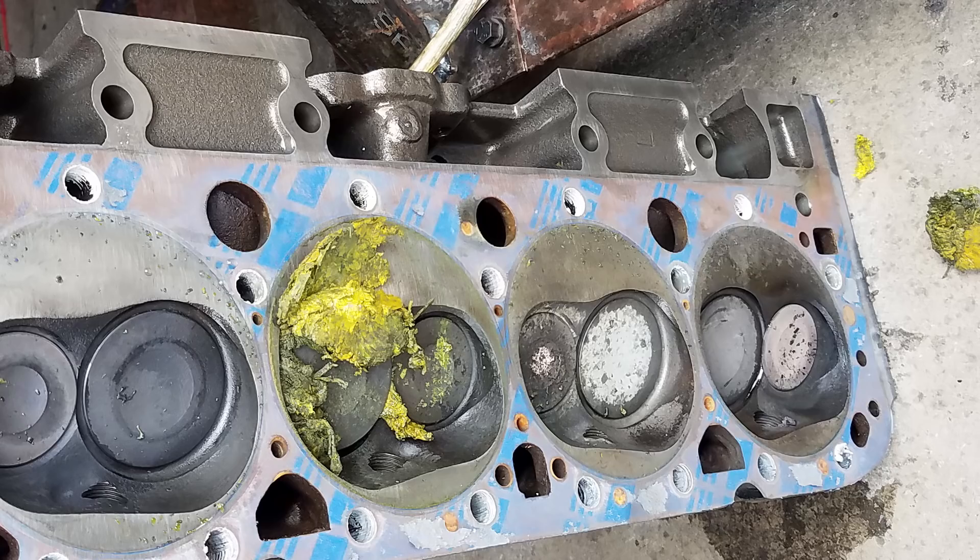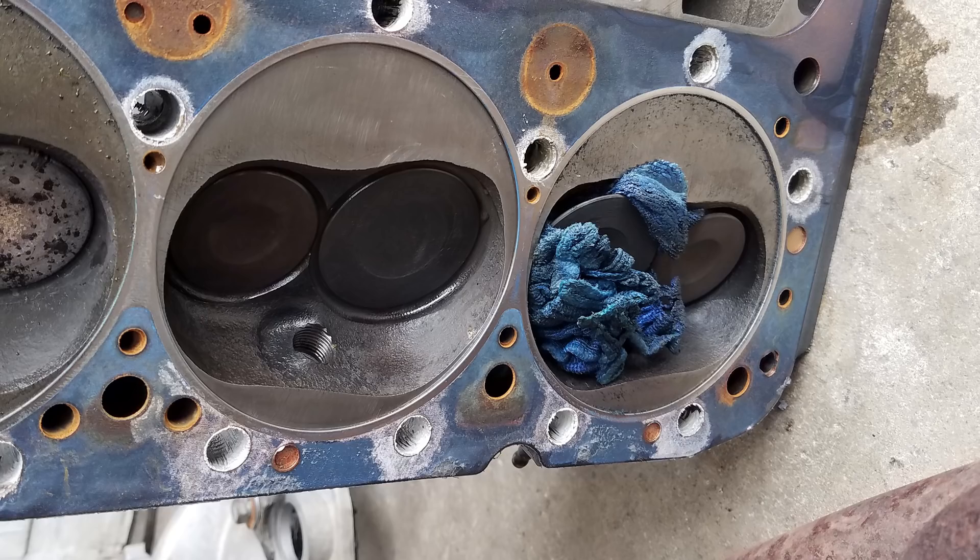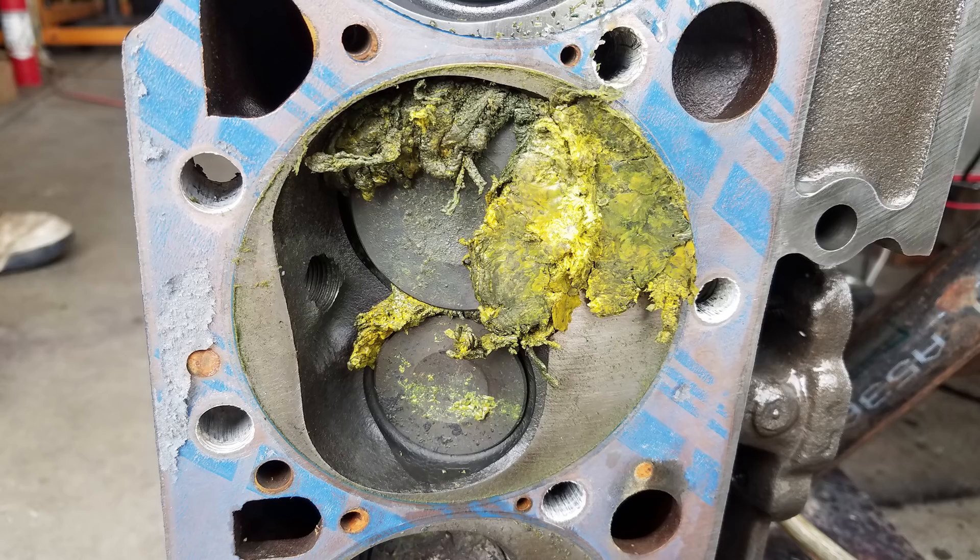As far as the aftermath goes, I got some photos here. The yellow microfiber actually sucked down kind of into the chamber and got stuck under the valve — that's why we thought the valve was stuck. The yellow rag was just wrapped around and built up into the valve stem, stopping it from closing. The piston had just been coming up and smashing on that rag too. It actually got hot and melted, so the rag was almost like plastic feeling — kind of solid after it got burned and smashed a bunch.